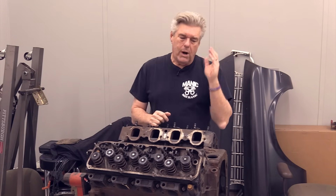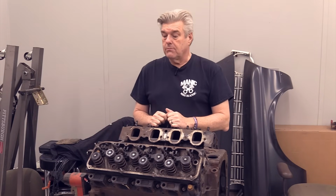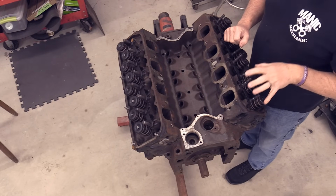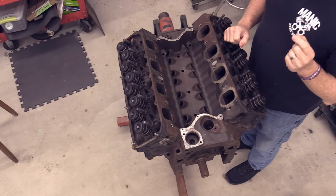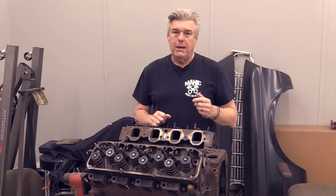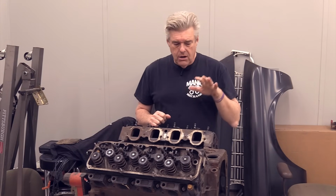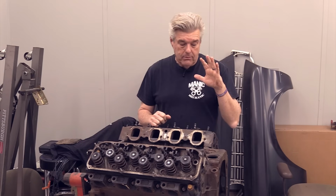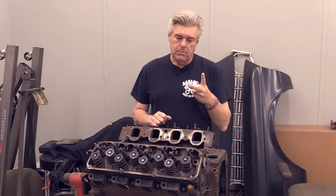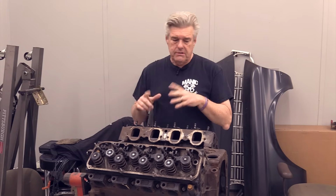And you may be wondering, why am I looking for a 351 Cleveland block? The reason is there's a nick in cylinder number 5 that's a very deep gouge, and it looks like from where the rodents got into this stuff and they peed down inside the cylinder bores, particularly on 5. I don't know what their problem was with cylinder number 5, but they had a real issue with it, and that cylinder needs to either be sleeved or I need to find a replacement block.